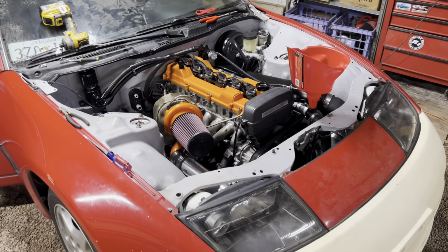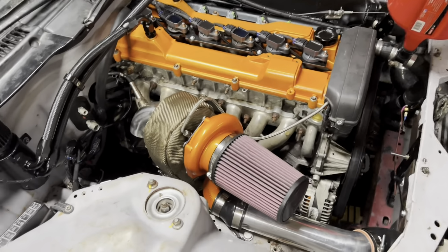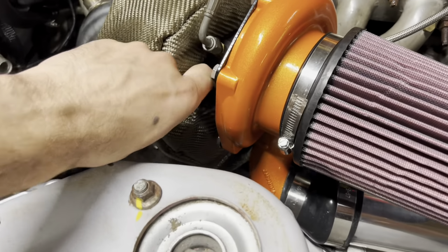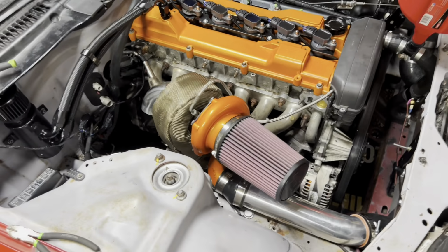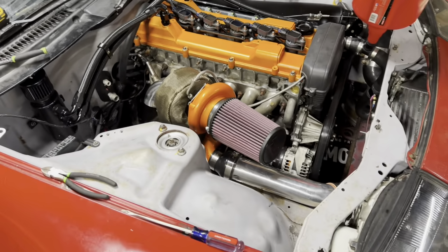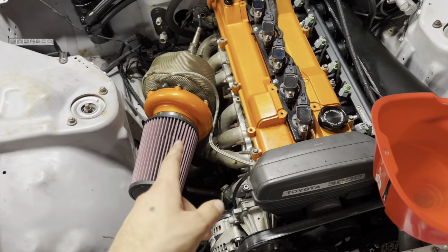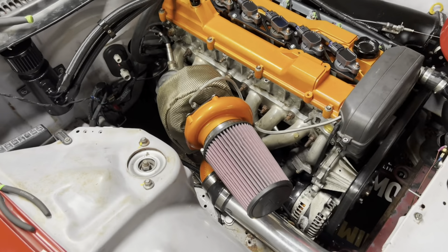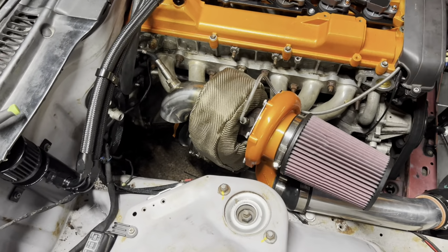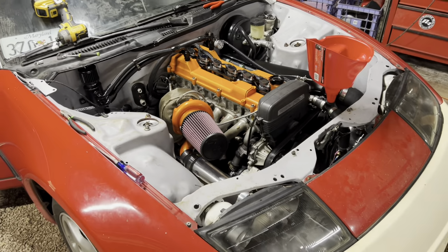All right, we got it to start, but we have a big exhaust leak, which I'm sure you heard, and it is going to be one of these bolts here. Now this is an exhaust turbine housing bolt, and it's on the very bottom. I know exactly which one it is, and I'm probably gonna have to take off the whole front of the turbo and the drain line, and it's gonna be a pain, but I do need to get that together, unfortunately. But that's the knocking sound you're hearing, is an exhaust leak, nothing huge.